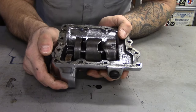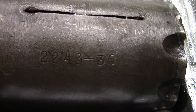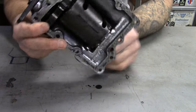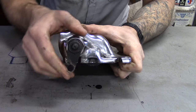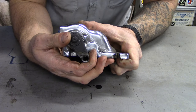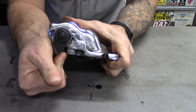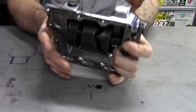It's a pretty simple mechanism. You have your shift drum — this one happens to have a '36 part number — and your detent spring here. The deal with these is every gear that you shift into, the arm moves, unlike a ratchet top which returns to center. Because as you're moving through your shift gate on your tank shift, you're moving to each position, engaging each gear. These are good for tank shifts.